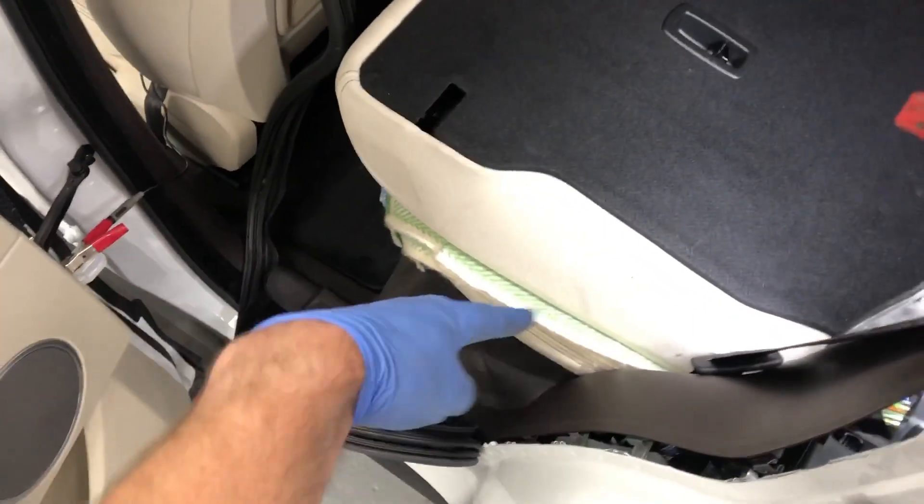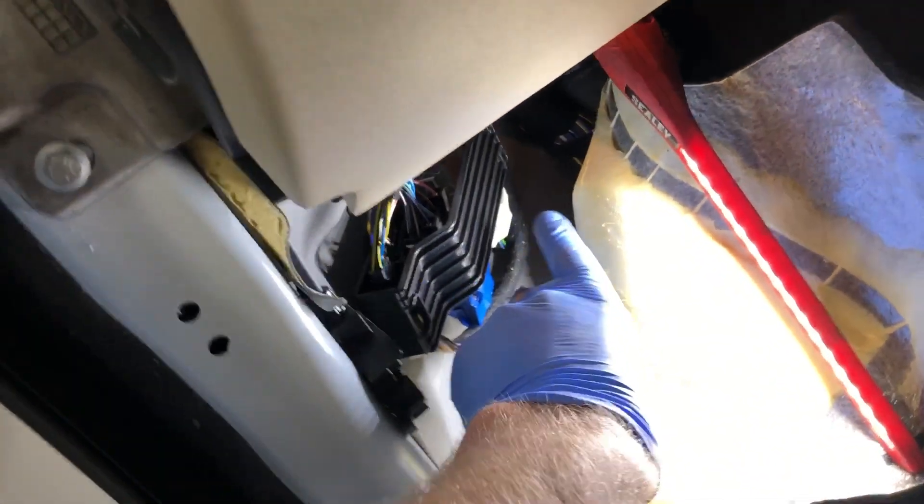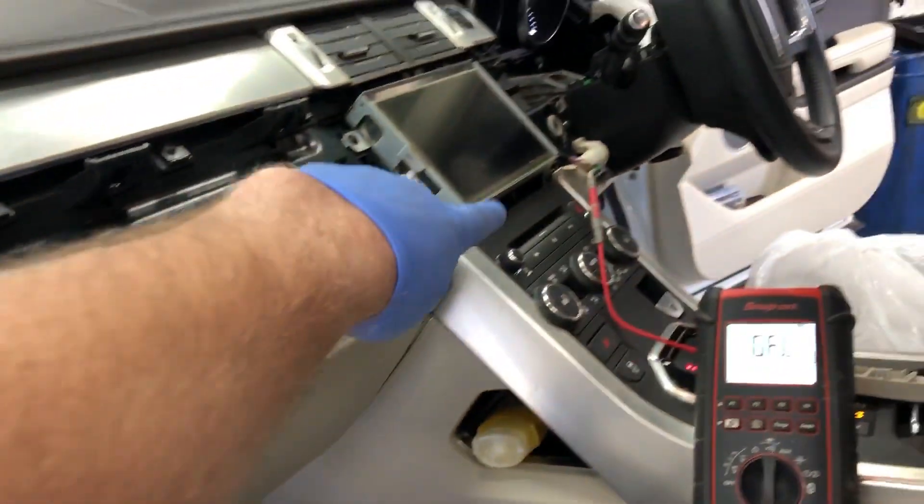The parking module itself is here in the nearside rear quarter behind there. The wires run down this big loom underneath the seat, along the sill, round this corner, up into that one connector, and then goes behind the dash over to the switch pack.